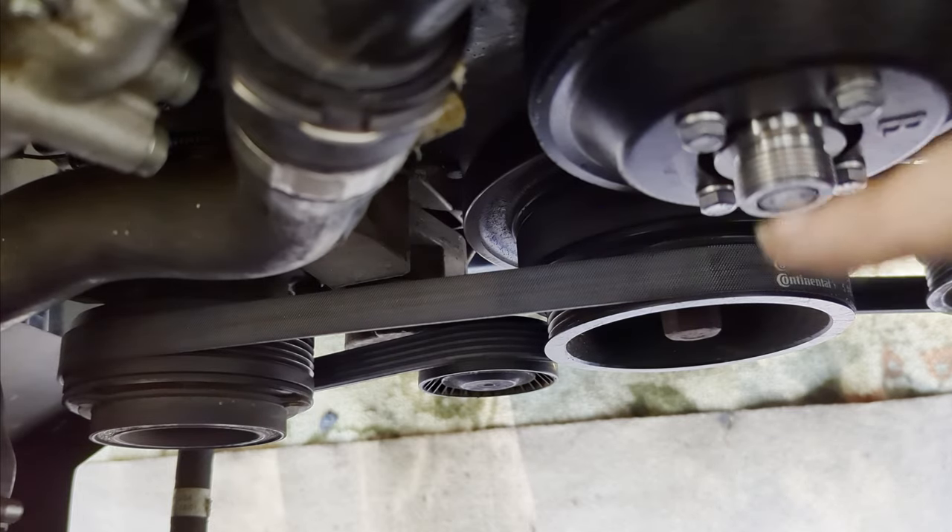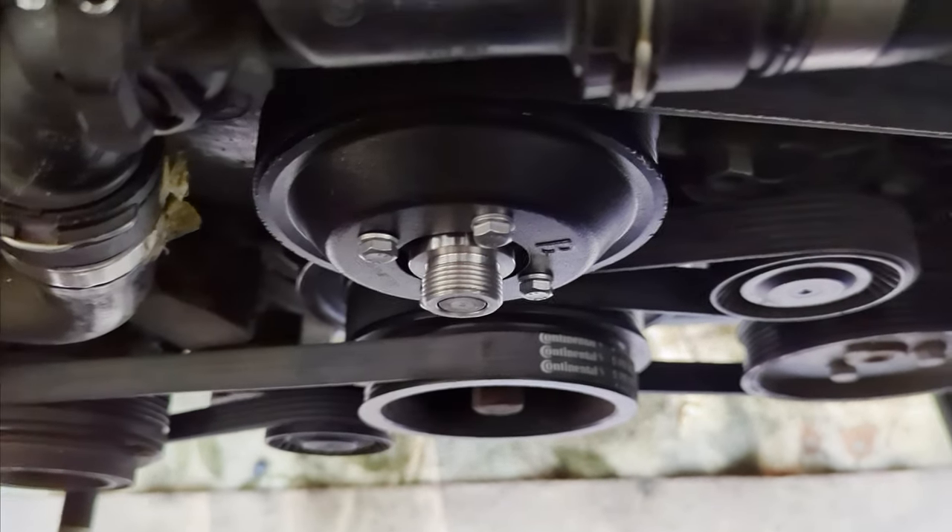Now we have the drive belt and the AC compressor belt replaced — it's that easy folks. Also, one more thing before I forget: after you get your belts on, do not forget to tighten the four bolts in your water pump pulley — remember those are only finger tight, so tighten those up. And there you have it — we have been successful at replacing the damaged water pump, getting the new aluminum water pump pulley installed, and installing brand new drive belt and AC compressor belt. This is part two completed in my project so far. I hope this helps you out. Be sure to hit that subscribe and the notification bell so you don't miss out on the next part of this project. On the next video I'm going to show you how to replace your thermostat. Also don't forget to check me out on Instagram at Cool Cat Terry. Let's get it — I'll see you then.